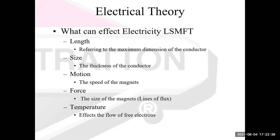In fact, generally speaking, the resistance of components increases as the temperature goes up. And so you'll have some components, and we've seen this with ignition modules and computers in cars and various sensors, that work fine at regular temperatures, 70, 80 degrees. And then they get to 150, 200 degrees, and they stop working.